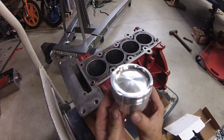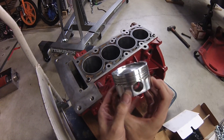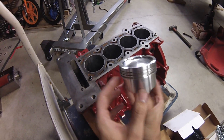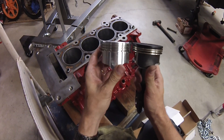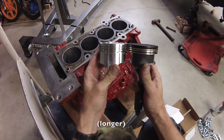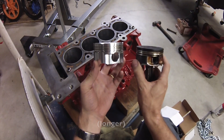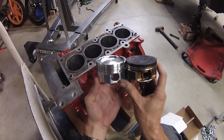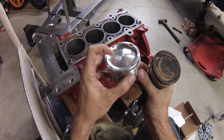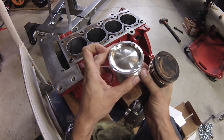These are the new pistons. They look real nice. Half-mill oversized. These are forged aluminum. They're larger compared to the stock piston, as you can see. That's going to help to prevent wall slap because they've got larger skirts on the sides here. And they've got a dome on top to help to mix the air and the fuel for a cleaner burn.